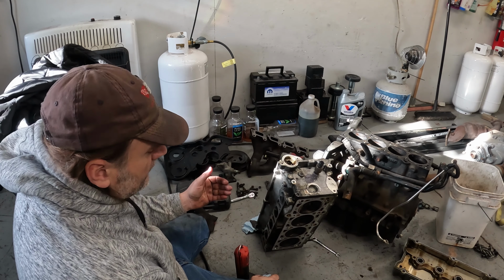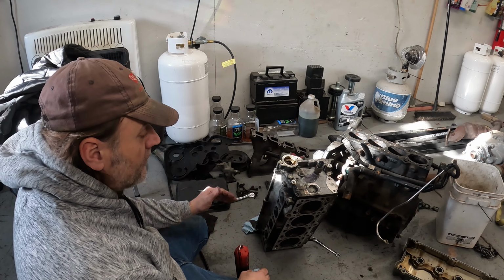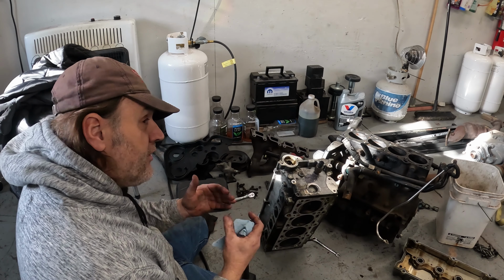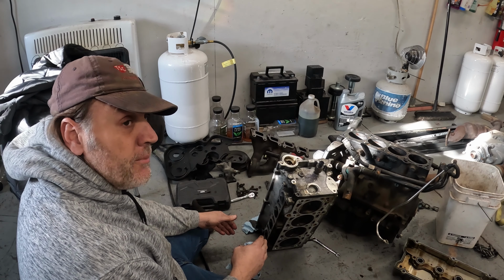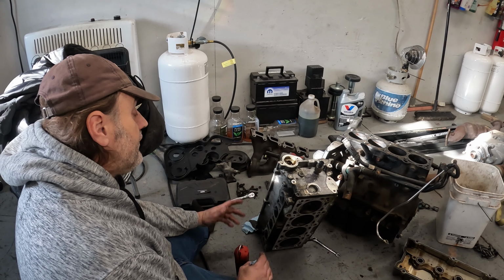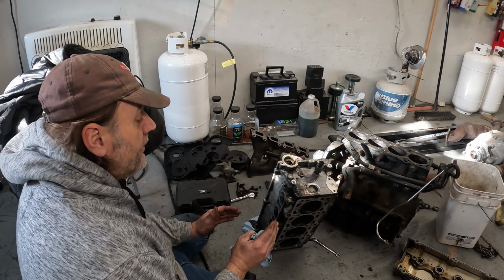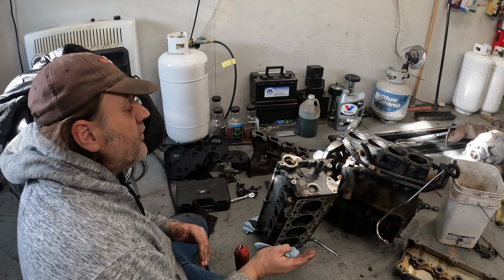And at that point, when you're putting new valves in, you're getting a valve job, so they're seating the valves correctly. So they all should be pulled out. Everything should be gone over. So even if you're reusing some of the parts, you're having the same amount of labor as if you're sticking all new components in it, or even having the head ported. So at that point, the amount of money you spend getting a cylinder head done, is it good?